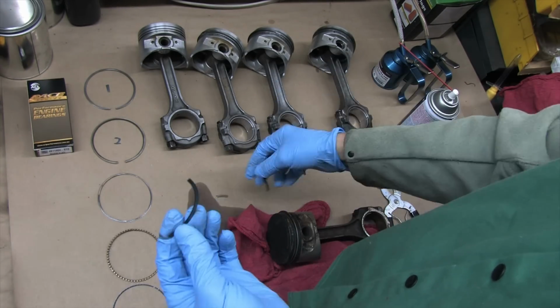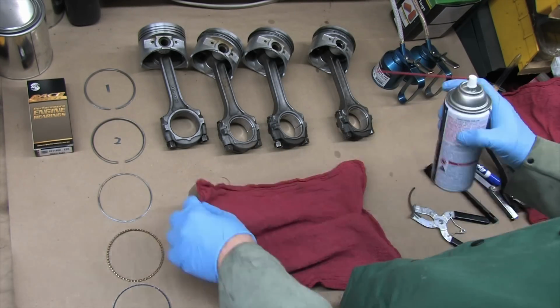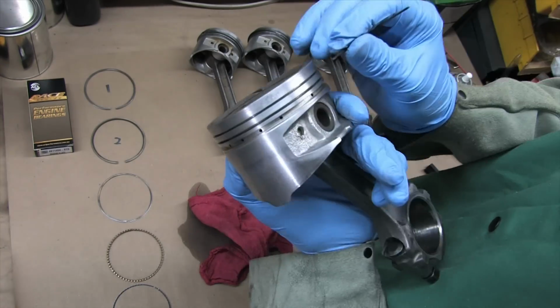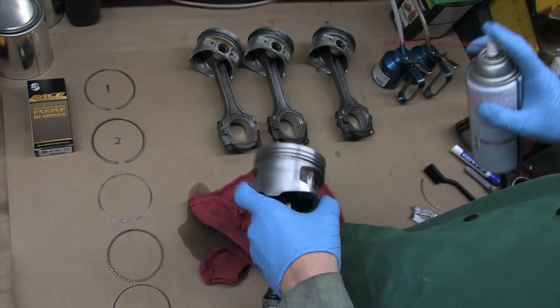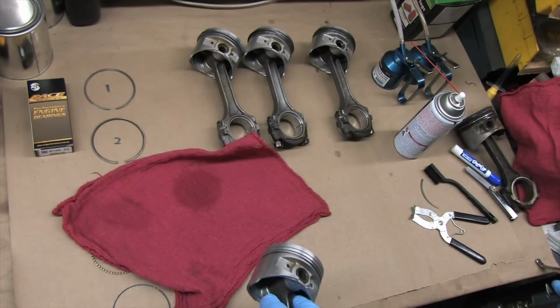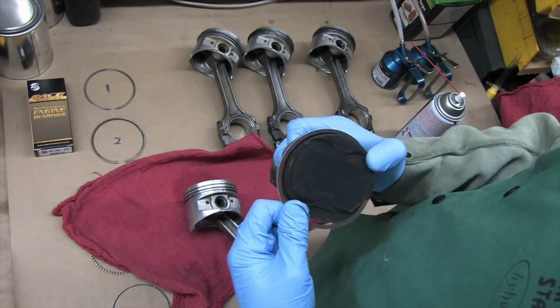the grooves is to break an old compression ring and run the edge around the groove to scrape out any funk. The reason you want to use ring pliers on the top 2 rings is because they're extremely brittle and prone to deformation and breakage. One mistake and it's trash. Even generic $4 ring pliers are enough to prevent it.